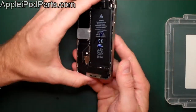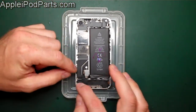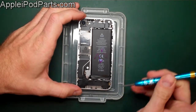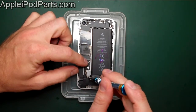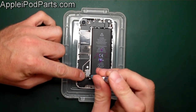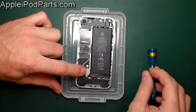I like to use these little trays because the screws are so many different sizes — I put them in compartments as we go, which makes it much easier. There's the iPhone 4 with the battery, camera, and all the internals. We can start taking out the parts inside. The battery connector has a small crosshead Phillips screw, so we remove that and pop it in a compartment.